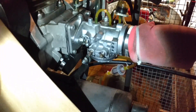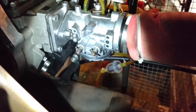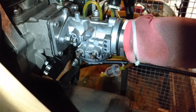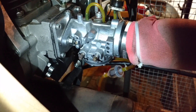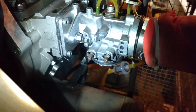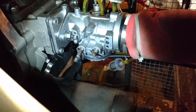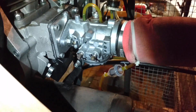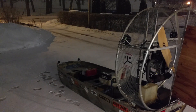Well, that worked a lot better. One thing I did was adjust these mixture screws — I adjusted the idle open a little more, so that seemed to help. These are the things you can't really adjust while it's running because the propeller is right here, but the manuals suggest you adjust them while it's running for optimal performance. So I'm really going to need to get some kind of remote adjustment system for these two needle valves. It's pretty snowy outside — I wonder if this would slide across the driveway on the snow. Stupid airboat tricks, take one.